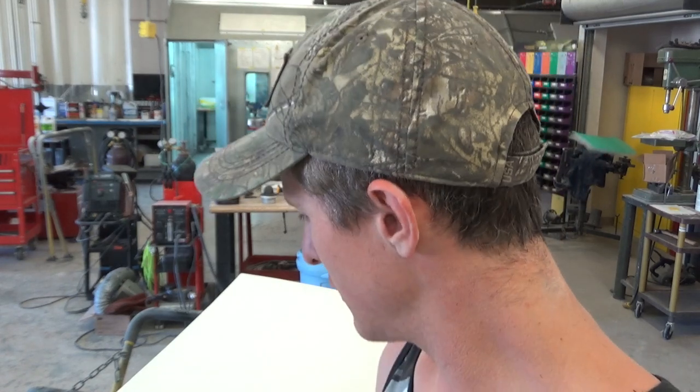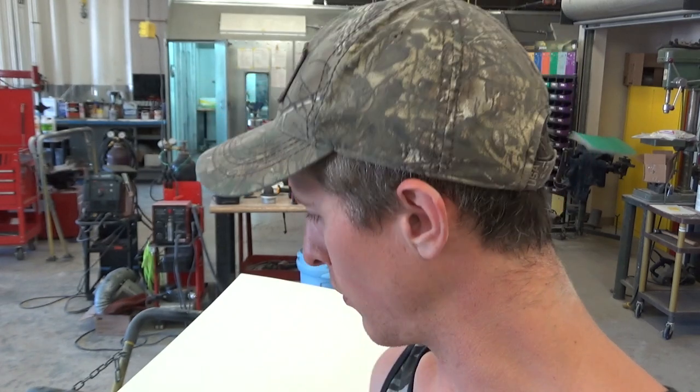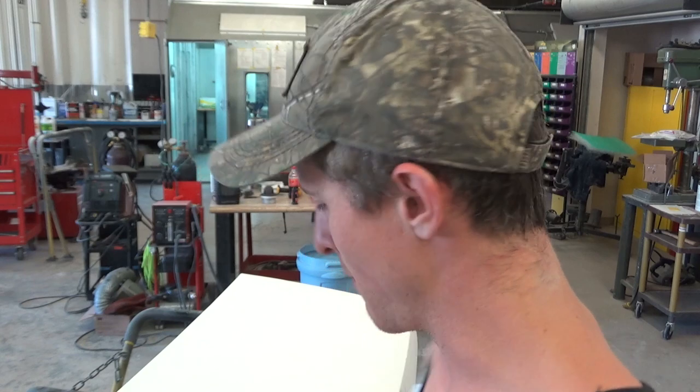I'm not going to show the primer surfacer — you've seen it in a dozen of my other videos. I will show you the block-out phase two — actually this is phase three, because we did body filler, then epoxy, and this will be the third time we block this panel out. We're going for super laser straight. I'm not sure how feasible this is in a collision environment where you're trying to match the rest of the car — if you have one perfect panel and the rest is kind of rough, your repair is really going to stand out. In this case we're redoing the whole car, so into the booth we go.